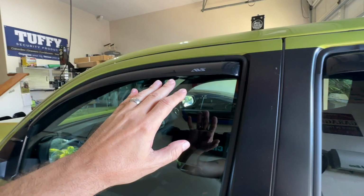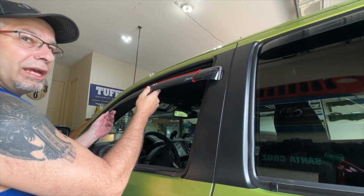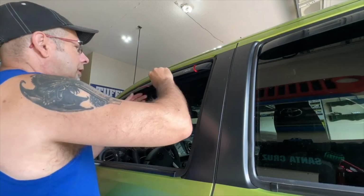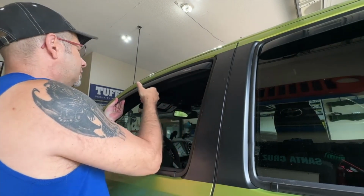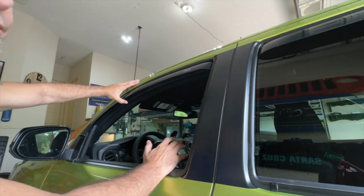Now, I will put just a quick little snippet in here so that you guys can see how they fit in the channel. Not a whole reinstall video, but just a little snippet right here. You want to start with the edges, go ahead and slip it up in the channel. And then you want to kind of pull them towards you. And then we'll put the window up to hold them in place for 72 hours.